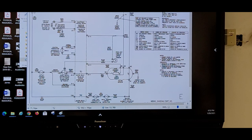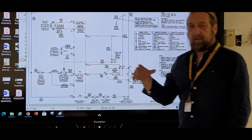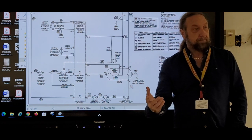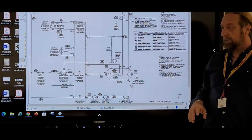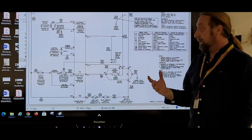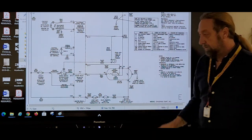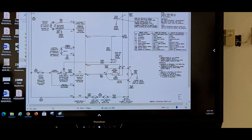Okay. So, going back to the beginning, if the dryer didn't work at all, like didn't light up or whatever, we have to have power to the board. And we said that it should be 120 volts coming into the board. So the first question was, where was line one coming into the board? And if I trace this circuit, line one comes down, goes here, goes through the thermal limiter, and to the board here, okay?